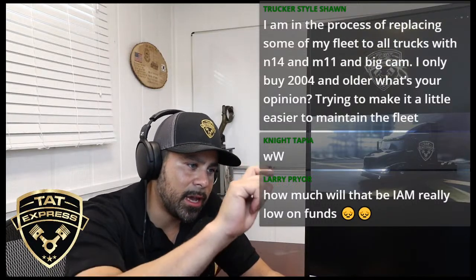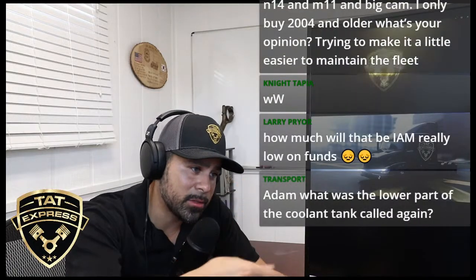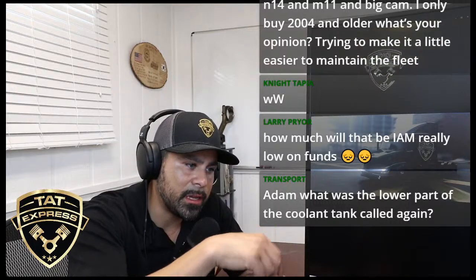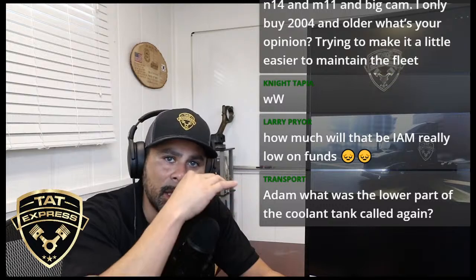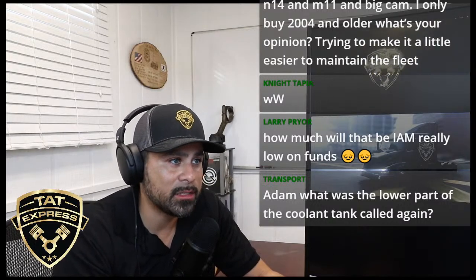Get some of that soot out of the intake side of that EGR cooler and the outtake side, either side. Put it in a cup. Let that soot dissolve in the water, and get another test strip and test it. If that test strip changes at all on any of the 3 different pads, then that's an indication that you have coolant going into your EGR and it needs to be replaced.